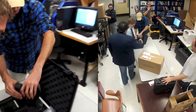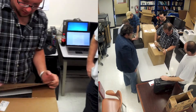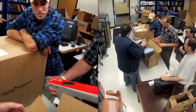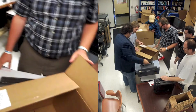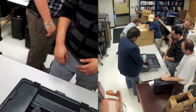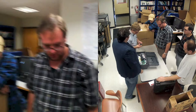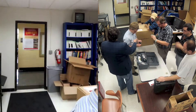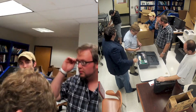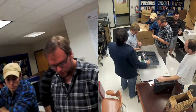I think there's one more big thing because the rest of the stuff might be similar still. This is high-tech forensic equipment. This is the FRED station — yes, it's for FRED. FRED is a computer system that is completely optimized for forensic purposes. Typically you have all these different parts you want to put together, but FRED is basically a desktop computer with different slots in it, and those slots are already write-blocked. So you don't need the extra hardware write-blocker, which actually speeds up the forensic investigation process.